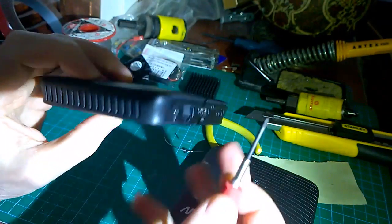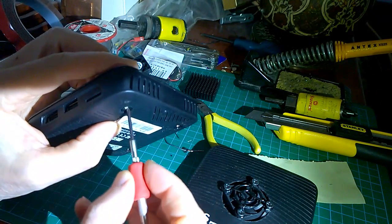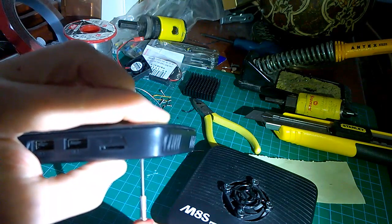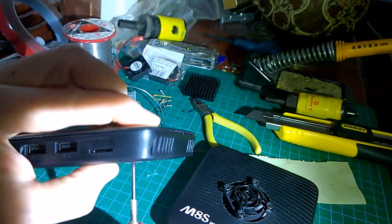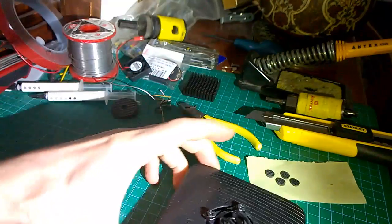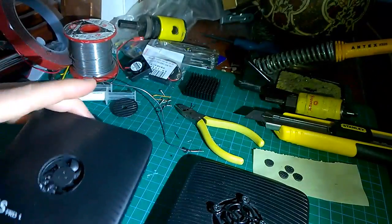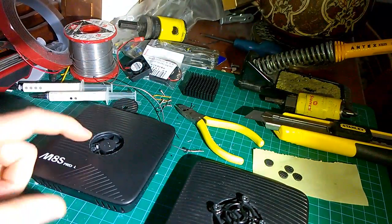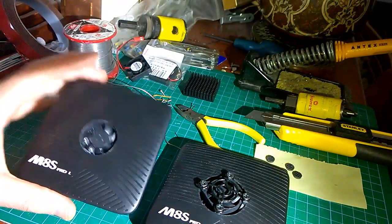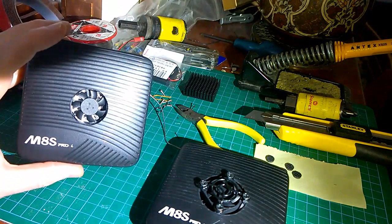You see, just a little tiny gap, about the same all the way around. That one's a little bit proud, so drag that down a little bit. There we go. Okay, that looks nice like that. Stick the little rubber feet back on, and it's all done. I won't do that now. Finish it off with a little chrome grill or a little black grill, 30mm fan grills, finger guards, whatever you want to call them, and that's it, all done.